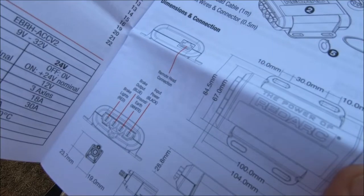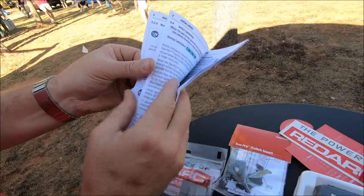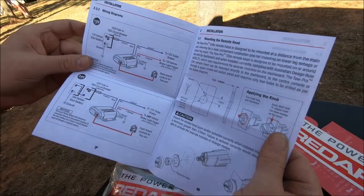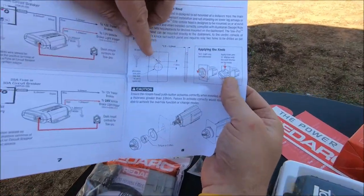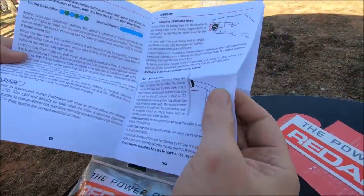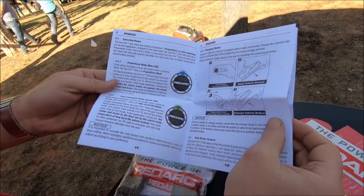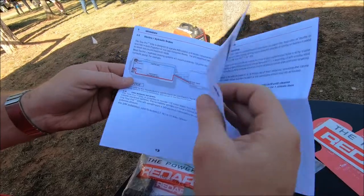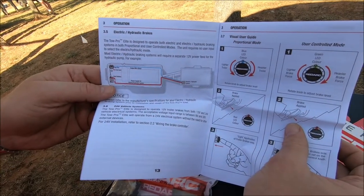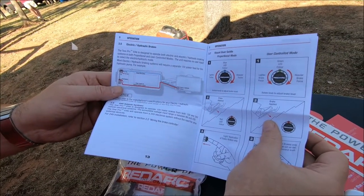There are wiring diagrams to show how the unit looks and how you should mount it — any orientation works, remember that. Wiring instructions on how to hard wire it if there isn't an OE plug to connect to, and how to install the switch if you're not using one of our switch blanks. Instructions on how to use the controller, how to read the different LEDs — green means user controlled, blue means automatic proportional brake controlling. Also worth noting, our system can work with electric over hydraulic brakes. Most boat trailers have electric over hydraulic brakes, so you don't have to choose a separate mode — it will simply work. Just connect your boat and go.